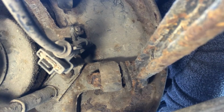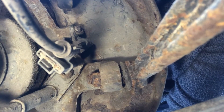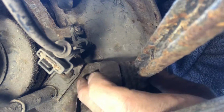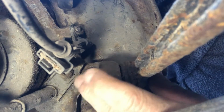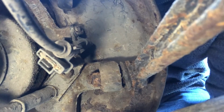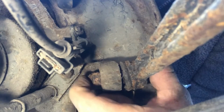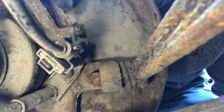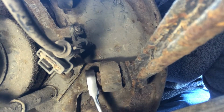Okay, so I've loosened and taken off the nut of the internal end. That can now be pushed out. The bolt can be pushed out. This end is a bit more tricky. I've just started loosening it, and I think it's turning. Now there is a hex hole inside the end for an Allen key to go in to stop it turning.